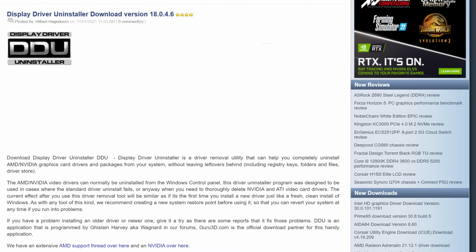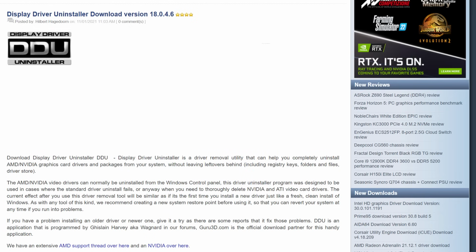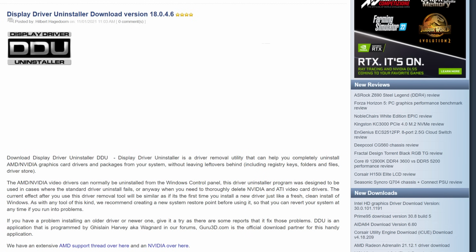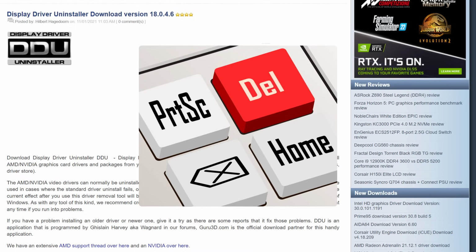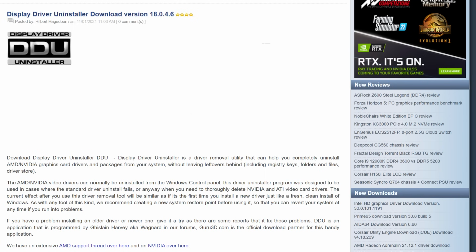Now, if none of that works, you tried all of this and it's still just not hitting above 80 watts, it's just not boosting at all, I'm going to link a video in the description to follow. Basically, this involves using a program called DDU to completely uninstall your Nvidia driver and everything with it. You might just have driver bloat, different things might be outdated, and you might just need a fresh install of your display driver completely. So instead of just installing on top of the one you have now, this is basically just uninstalling completely everything and just reinstalling a fresh driver.